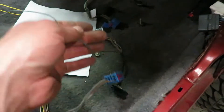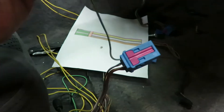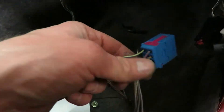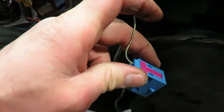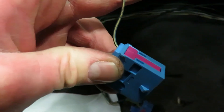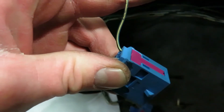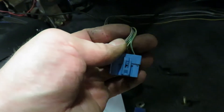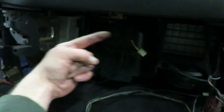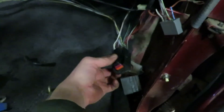Update: I went to wire this in and it actually has nothing to do with the throttle pedal. What this wire does — you can see it's not even going to the pedal plug — it goes straight from the ECU to the 109 relay. That's basically the trigger to turn the relay on from the ECU. So I don't even need to worry about routing it to the pedal side. I can unpin this side and run it straight from the ECU to the 109 relay, and we'll be done. It can go straight instead of having to come up and turn back around.